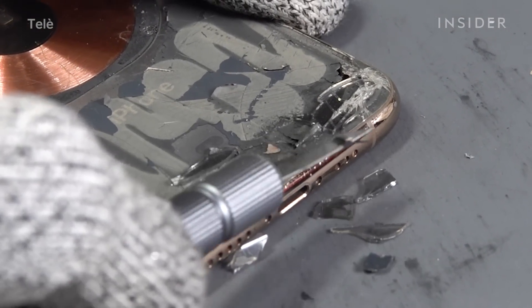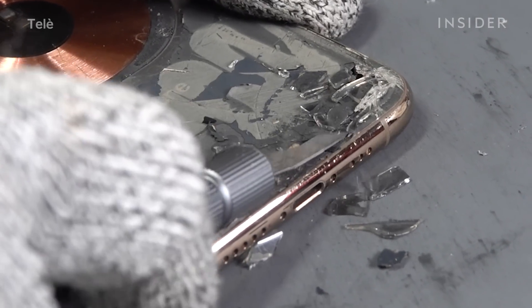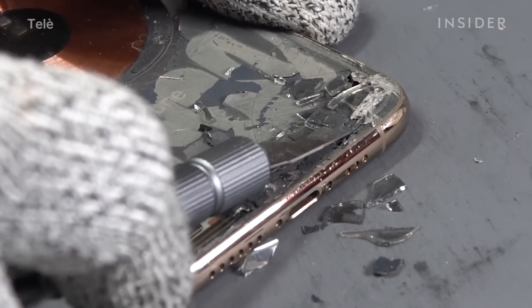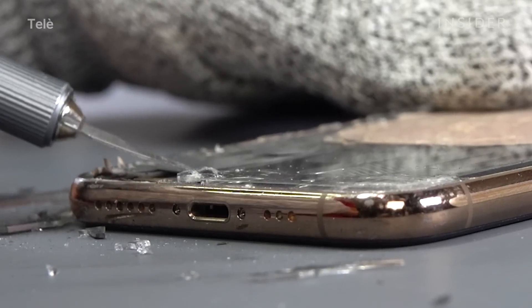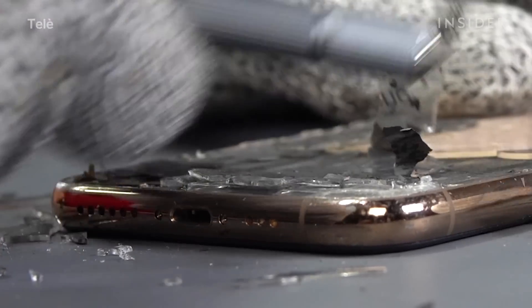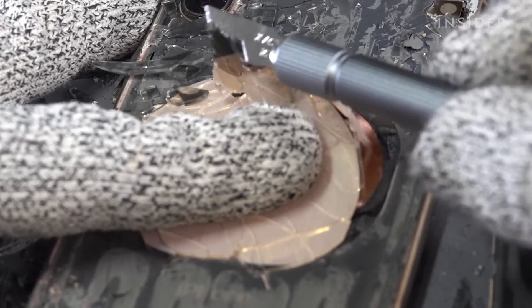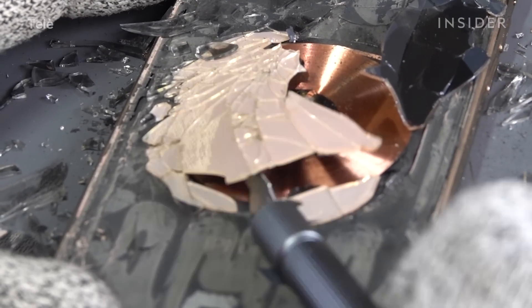If an iPhone has big chunks missing on the back glass and has easy access to get underneath, I'll go ahead with a blade similar to a scalpel and just pry off that glass. As you can see, the middle of the phone still has color in the glass.